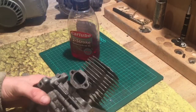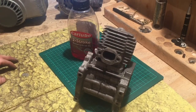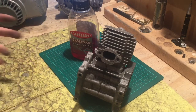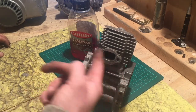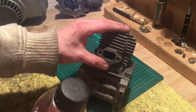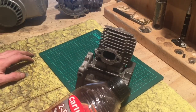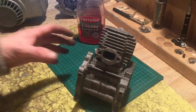That's your piston changed. Rather than paying somebody else to do it or going to get another engine — you can get these engines for like 50 bucks, but plenty of other 50cc air-cooled engines are hundreds and hundreds of pounds, and to get somebody to work on it is a lot of money. So to just know a couple of basic facts, undo some bolts, slide it off, remembering to use care — these things are very sensitive to scratches, you don't want to be scratching it. It's not so hyper-technical that it needs a specialist. It can be chopped and changed in minutes.